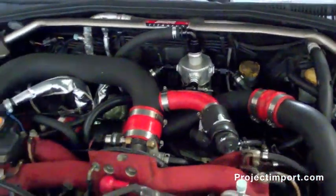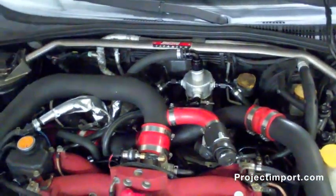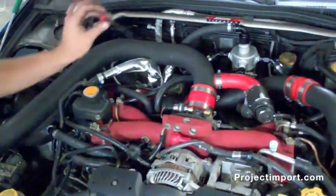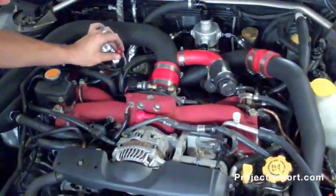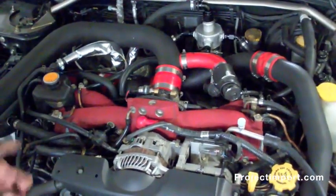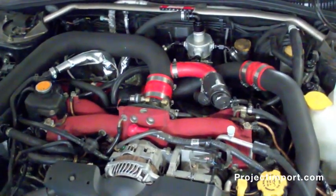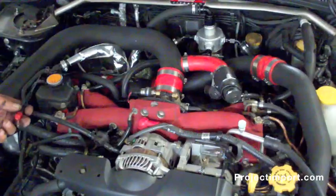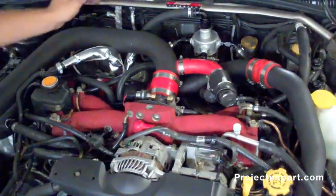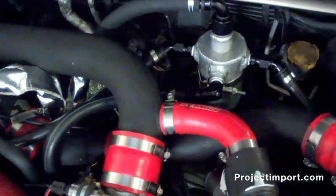That's our Moroso oil catch can. As you can see, the top port is actually the suction related to the intake suction side — it's actually sucking on the crankcase of the motor. The center port is going to our block crankcase, and each one of these ports is going to each valve cover. What we're trying to do is suck as much crankcase pressure as possible to help extend the rings out into the cylinders. Originally this car had a Y-pipe with limited crankcase ventilation. What we're adding here is a larger suction side from the turbo and individual suction from each port on the motor.